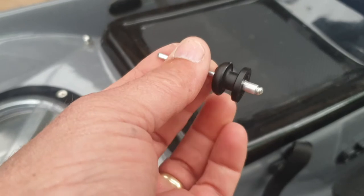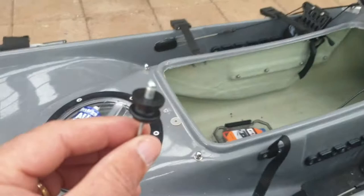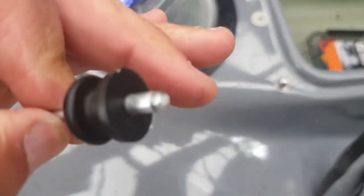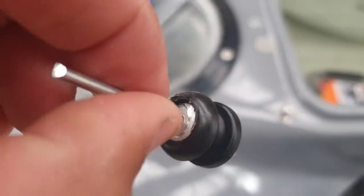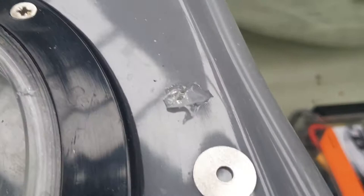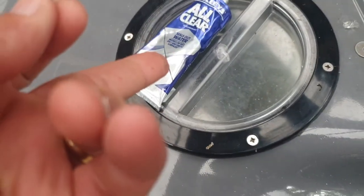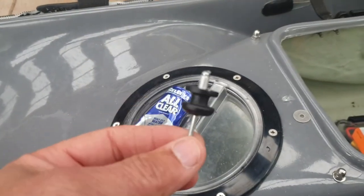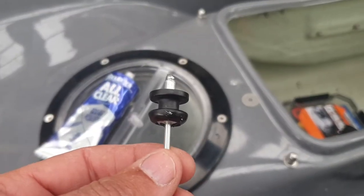Apply silicone around the tip of the pop rivet before you put it in, and silicon the shank before you put it in — that'll seal off the button. Then seal off the hole. I've got a little bit of Nirvana in the background, hope you don't mind. Just using Selleys All Clear — it's pretty good stuff. Whatever you do, make sure you seal it, then install the button. I'll do the same for the toggle and show you the end result.